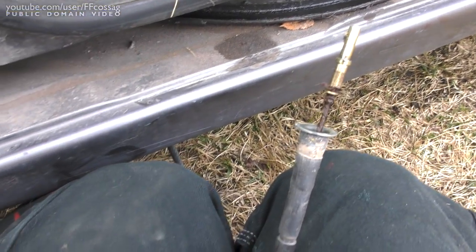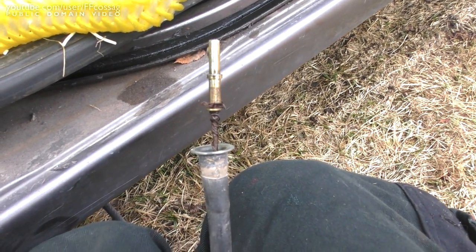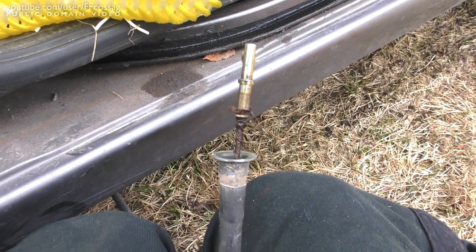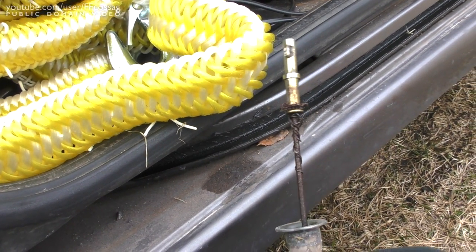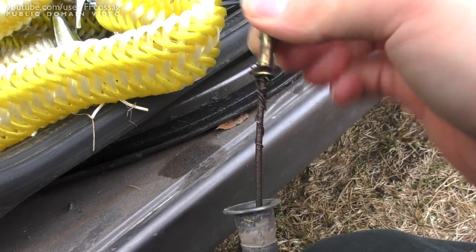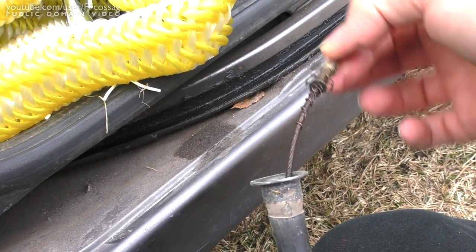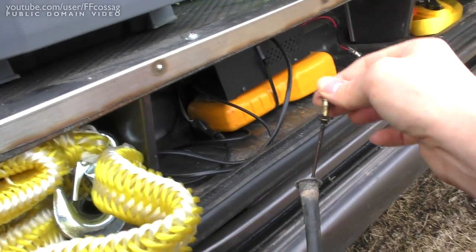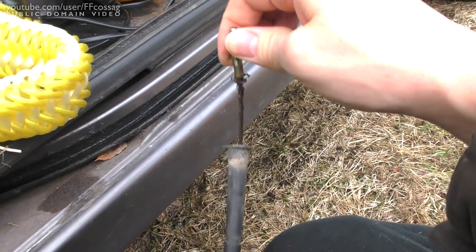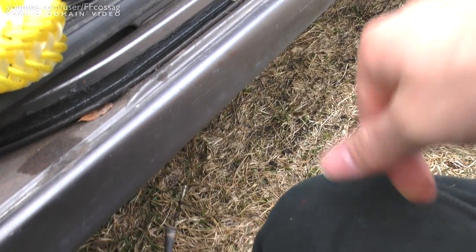I just took the drill to the end of the original wire, just to confirm that this is actually the old cable. And I'm pretty sure that's not supposed to happen. This thing has obviously suffered liquid ingress and it's all rusted and horrible and broken. It's obviously snapped somewhere along the way because it isn't spinning at the other end. The wire's not supposed to be five centimetres longer than the actual housing. So that thing is absolutely toast.